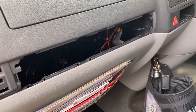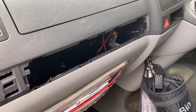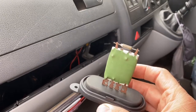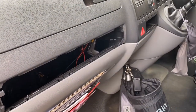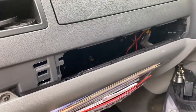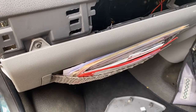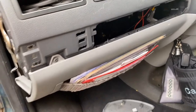So it's actually quite a straightforward job. The first thing to obviously check is your resistor first, cause sometimes it can be that, especially if it's only blowing on number four or something. So that's the old resistor — I've put the new one in, but it was obviously the motor on this one. I ordered a new resistor on Amazon, so I've left that in and I'll keep that as a spare. Try that first, then obviously use a multimeter to check your power to the fan itself, just to make sure there's power going to it, and then you can eliminate everything else. And obviously the fuse as well — I checked the fuse under the bonnet just to make sure it wasn't that before I went and bought a new motor. But anyway, that's all sorted. Job well done — pleased with that, and better than £400 at VW I think.